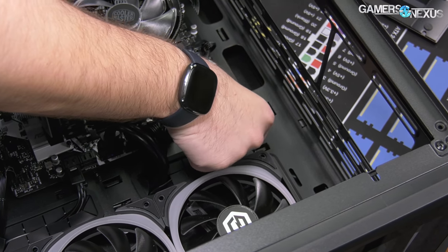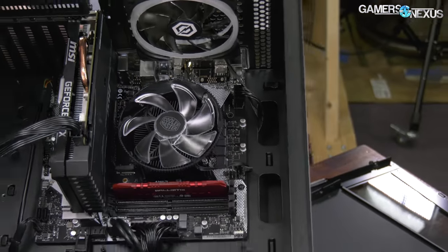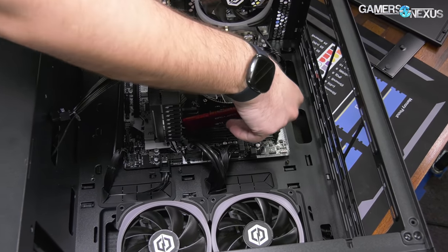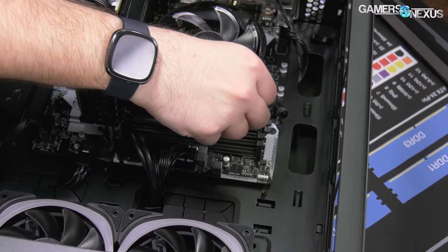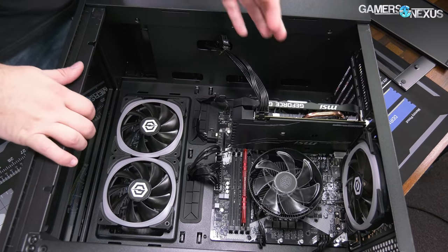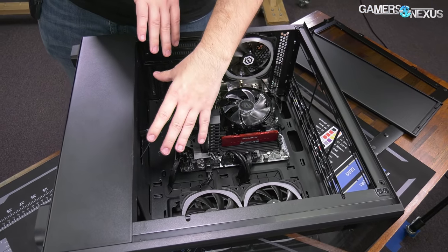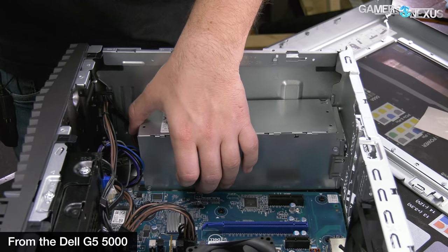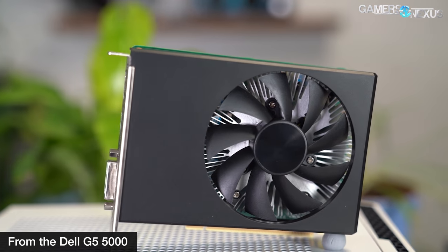The 24-pin and USB are both tucked in right next to each other — it looks good. There's a little bit of flex on the board on the right side — those holes are for a VRM heatsink which is not included on this model motherboard. The memory's in the correct slot. It can actually fit four sticks as long as they're not too tall, so there's a little bit of clearance there at the edge of the cooler. EPS 12-volt is socketed and cable managed. I would have routed the HD audio through a different hole, but the fact that I'm criticizing their choice of grommet for cable routing means I'm not looking at proprietary motherboards, power supplies, or garbage video cards. This is a much better start than the other one.